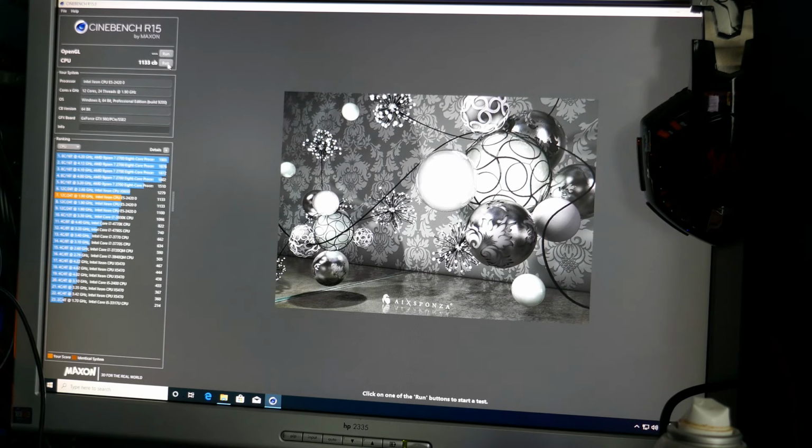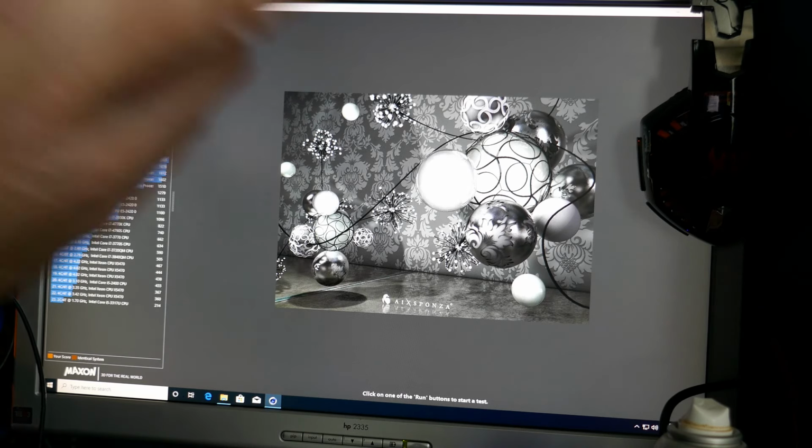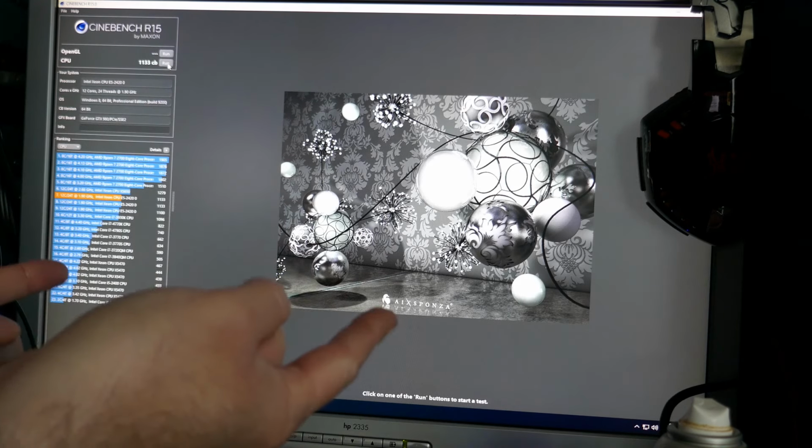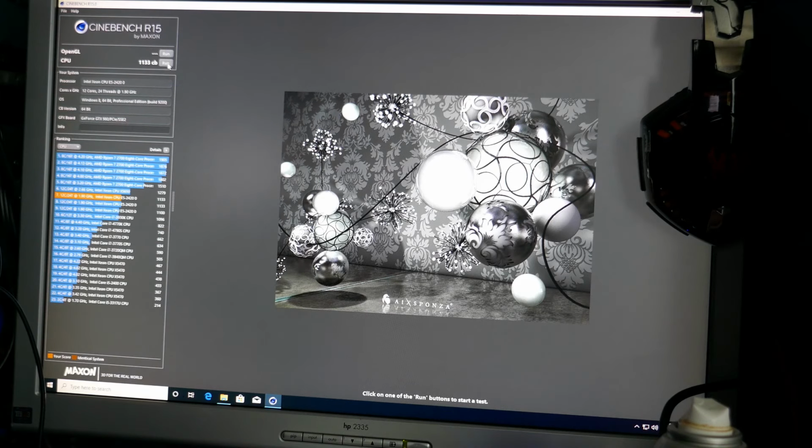But anyway, I'm looking at processors for this. It looks like the V2s are as high as they went for these 1356 motherboards. It's interesting because the BIOS firmware that I downloaded for this motherboard says that they added microcode for the E5 2600 V2 chips, but as far as I can tell from the Xeon list, the 2600s were only available in the 2011 socket, so I don't know why Dell would put a microcode into their motherboard for a processor socket that's not on the motherboard. Which actually makes me think that there's no difference between the 2011 and the 1356 processors and the motherboards. It's just a socket change and nothing else. Anyway, you didn't hear that from any official source, right?